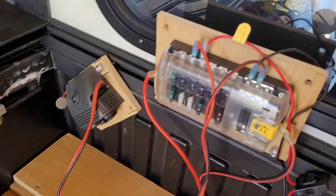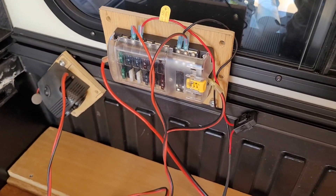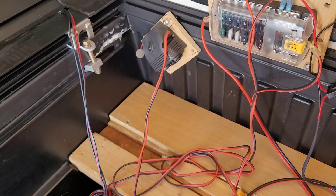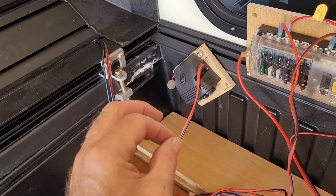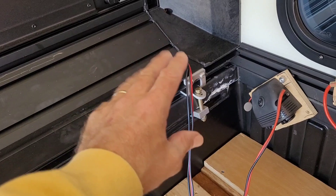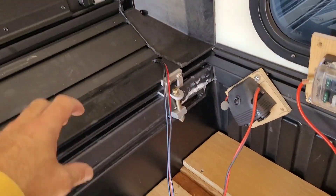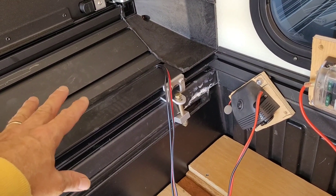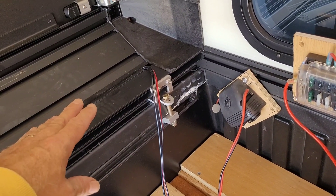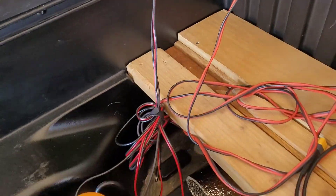I'm going to talk about the right way to supply and protect your wires in a truck camper. Every time you run electricity over wire, particularly in a mobile solution where things are getting abraded and jiggled, you can degrade the insulation. If it's in direct contact with metal, you can get shorts, which will flow electricity into the ground — your chassis — and you'll have an over-amperage condition that can melt the wires.